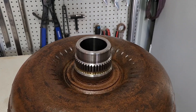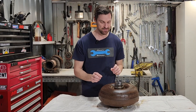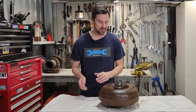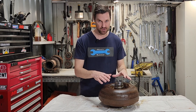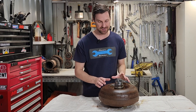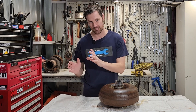This spline usually has a gear on it, and this gear drives the transmission charge pump. The transmission charge pump provides lubrication and cooling for the transmission — that is oil — it also provides oil for the engagement of the clutches, and it provides the oil to fill the torque converter so we can operate it.